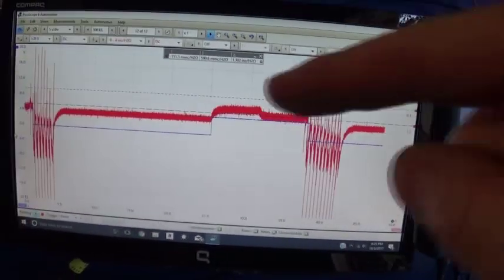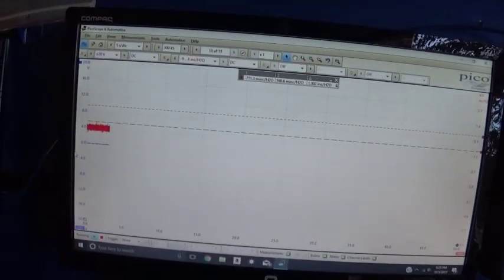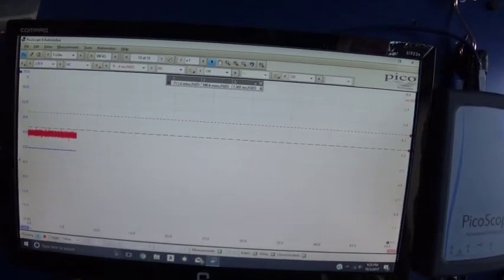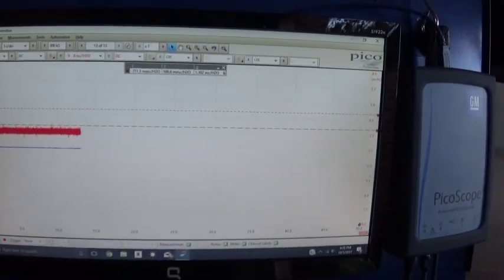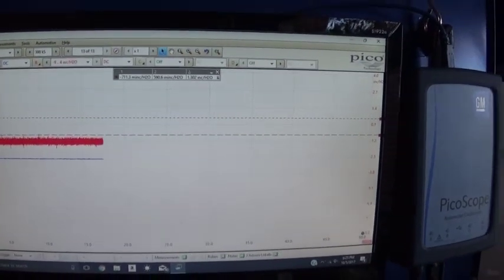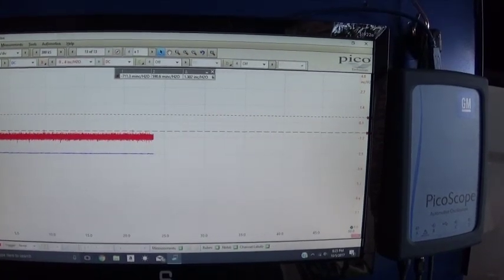Again, like a minute ago, we could see that my switch did open. That's because I did not have enough time to shut this valve off to seal the system. But this is it. This is a confirmed fix. I'm happy with this. You can see it's holding the vacuum. System is sealed and no more leaks. My purge valve is working just fine, and this should be fine.